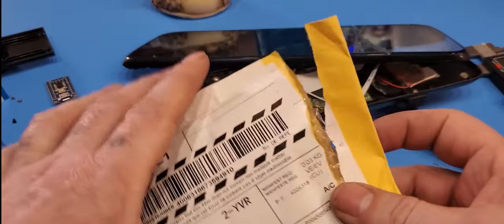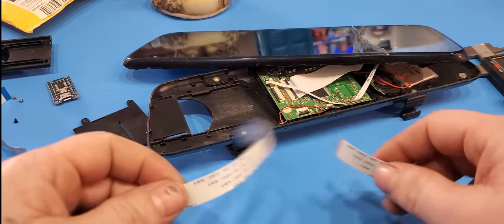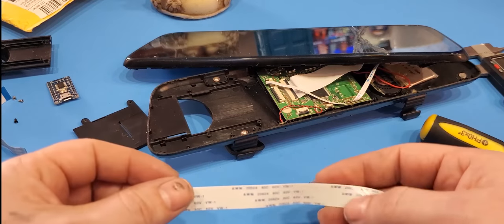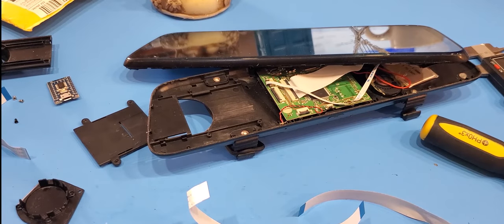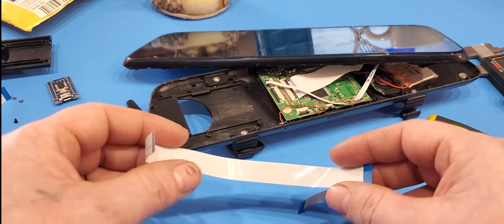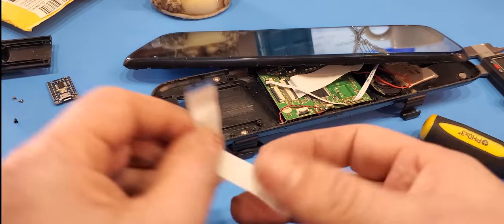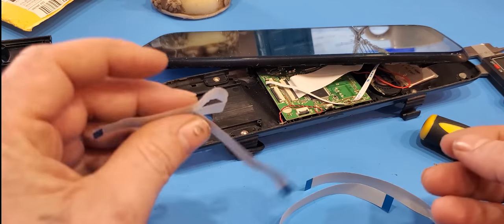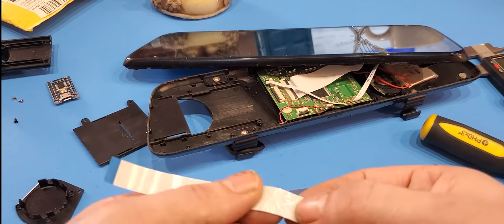After that, wait your month or two weeks and then get your cables. Before you order, you'll also want to get the length. I believe I ordered 24-pin, 0.5 pitch, and 150mm. Just make sure you get roughly the same length or a bit longer than the original cable. This isn't the original one anymore anyway — it's already a replacement and has gone through hell in my packaging for the past year, so I probably won't use this one.